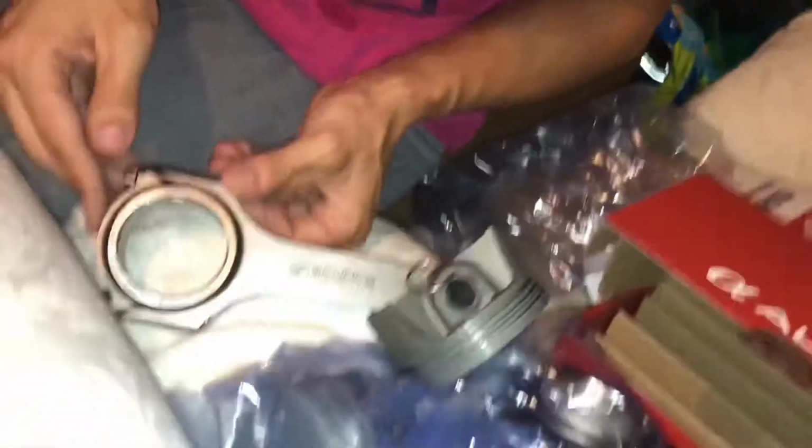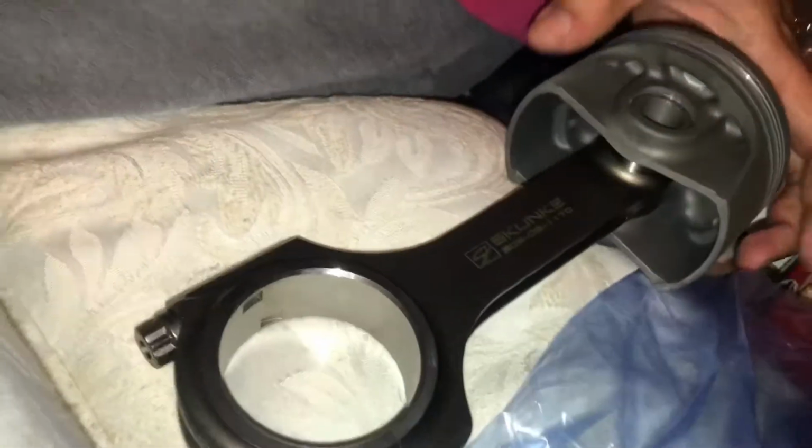So I'm gonna go ahead and knock this last one out. Get all 4 of my pistons done. Then I'll throw the bearings into these little braces here. I still have to break them apart because they're fractured. So fractured means that if you look on the inside, you can see that there's no cut. So I'll have to take the rod bolts off and actually break them so that it's a perfect match. The reason why they do that is so that it is a perfect seam. There's no machined edge that could be slightly off and not seat properly. So we'll go ahead and get this last C-clip in so the wrist pin doesn't fall out. Get our bearings on there and get them thrown into the block so we can torque it all down.